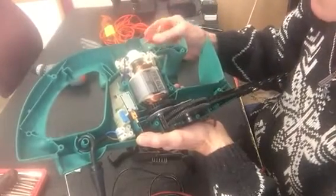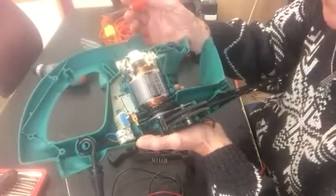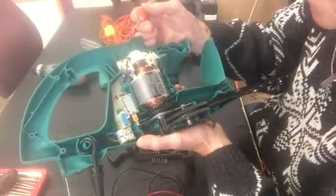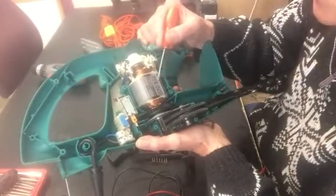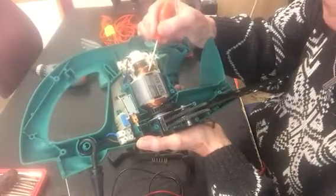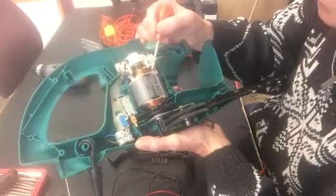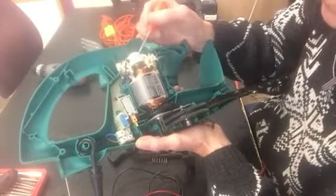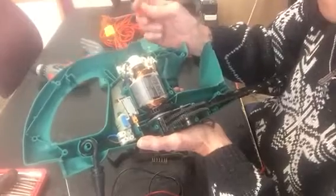If you've still got no joy in finding it, then the only thing that's left after that, really, I suppose, is a fault in the motor, and you won't be able to replace the armature or the stator, the field winding. This will come in one bundle. You know, years ago you could get these separate and you just replace the field winding, but not now.